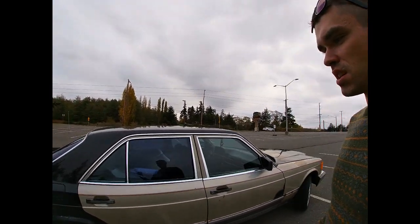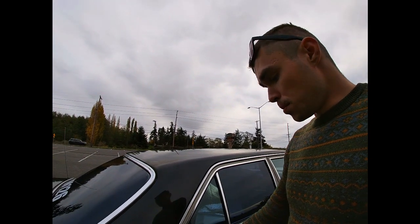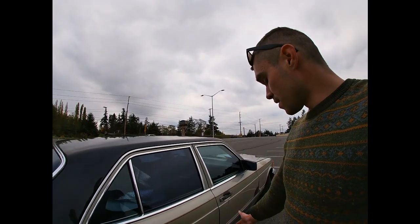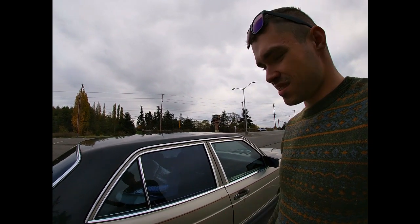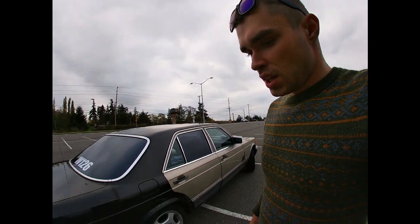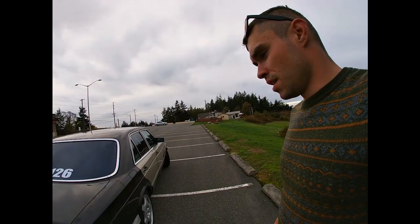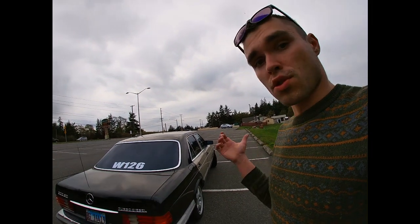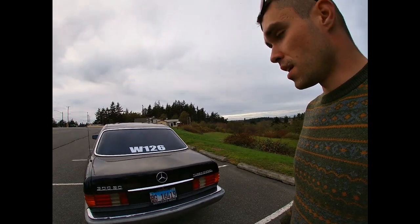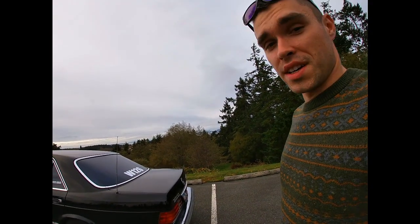Another exterior thing: I replaced this door but it doesn't close or open well at all. I found out there was actually a small crease in the rocker panel — you can't really see it from outside but when you open the door you can see it. I'll probably have to take it to a body shop so they can pull that out so the door closes normally. There's a lot of work on this car — and I only mentioned suspension, brakes, and exterior. There's a lot more things that need to be done.